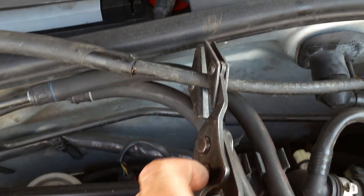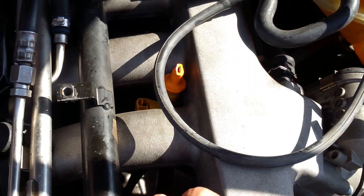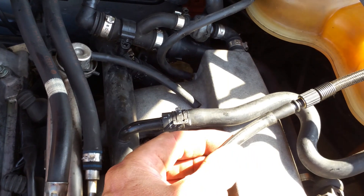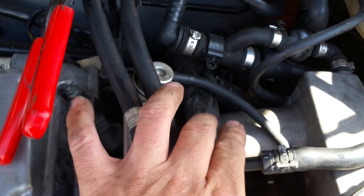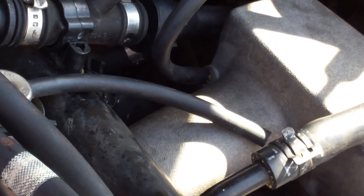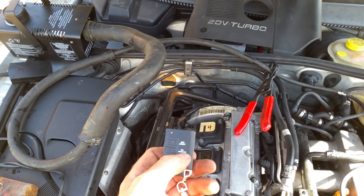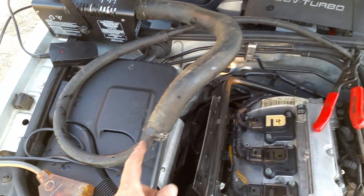I got 3/16 hose in there with this clamp here to clamp it off, because I'm using this air pump to pump air into it. When I clamp this off, I turn on the air pump and pump the smoke to pressurize the system a little bit. I just took the vacuum line off right here — it goes right to the intake right there. I know it's dark and you can barely see it, but it just goes right there.